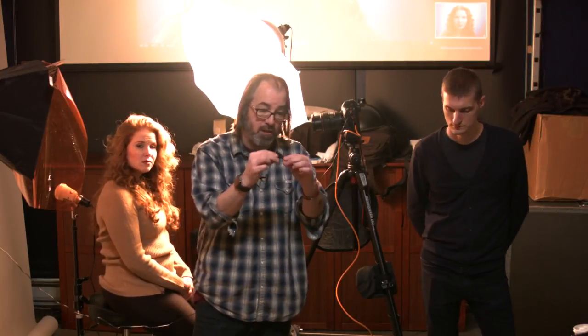Those ones you don't ever want to touch with your fingers. You should wear gloves or use a little piece of clean tissue, but not Kleenex Plus, because that has lotion on it. That will certainly break if you get your fingers on it. So halogen type ones, the more compressed ones, you can't touch. But ones that look like regular light bulbs, you can touch for the most part.